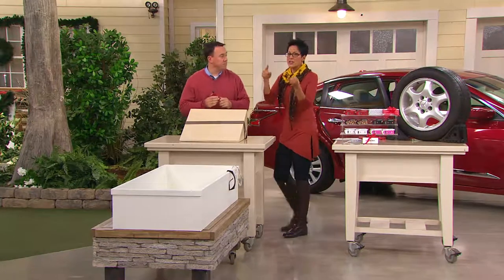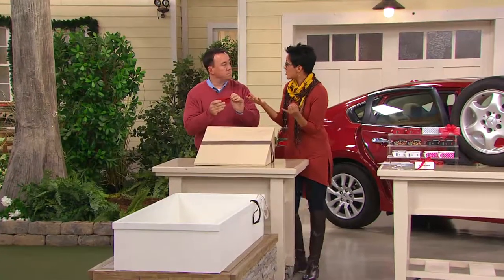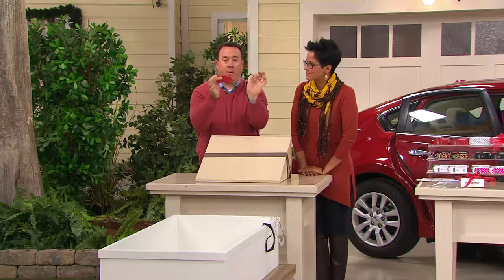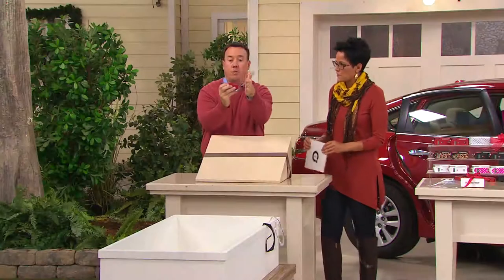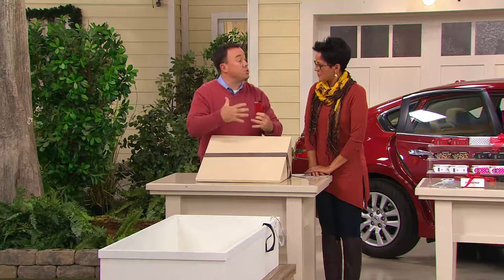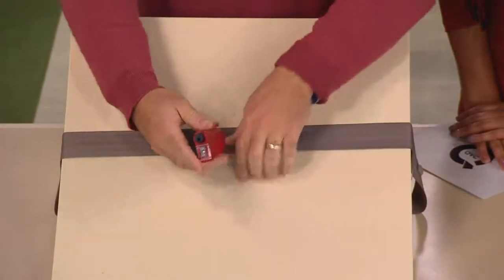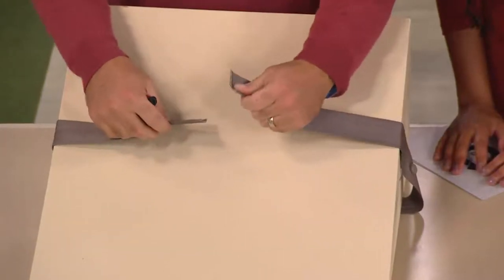And that's how you know whether or not your car is safe. If you're running on low tires, you're not being as efficient with your money. The next feature is a seatbelt cutter. That same tread depth gauge that pulls out — there's a very, very sharp blade in here. It will not cut you, but it will cut a seatbelt. The same seatbelt that saves your life can also entrap you. It takes 6,000 pounds of pressure to tear a seatbelt. But when you have the Swiss Tech, all you do is pull this up through, and in literally a second that seatbelt's cut and you're out the door.